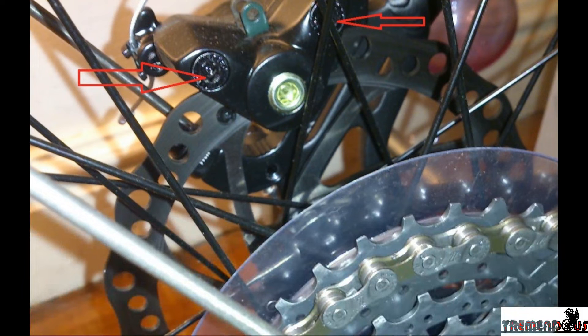They are pretty tight. So, when the caliper is mounted, this will actually help you to apply your force and unscrew those parting bolts. No need to fully remove them, but if you just break them loose, then the rest of the work will be easier.